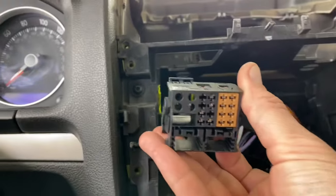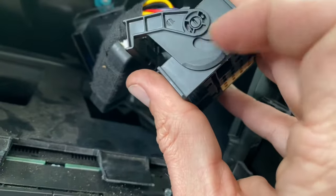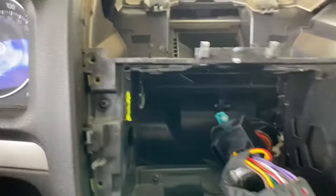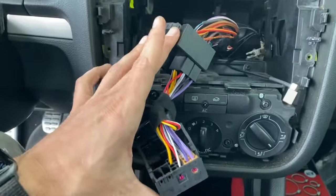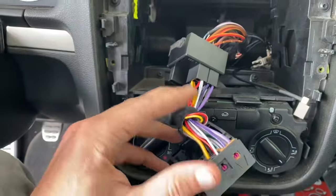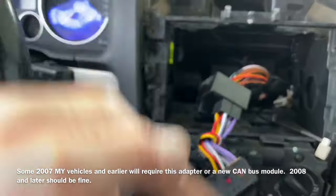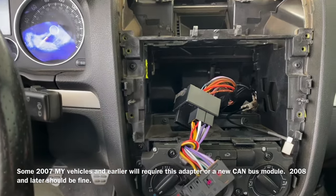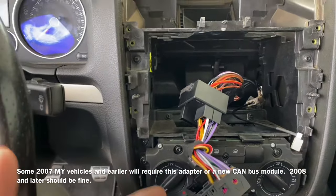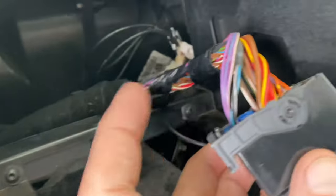On the back you're going to have this channel block — there's this lever, pinch, pull, and this is going to pivot up and release it so it'll just slide right out. What you will see different on my car is this adapter that I got from the seller — I'll try to remember to put in a link in the description. But this allows my steering wheel controls to operate it, as well as for my year of Mark 5, you need to worry about battery drain depending on your CAN bus control module. This will eliminate that so that when the car is off, it's not going to drain the battery. That's why this is here — this is otherwise the stock part, same idea.